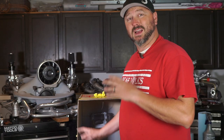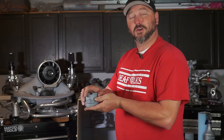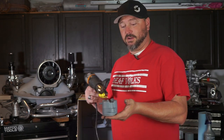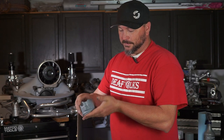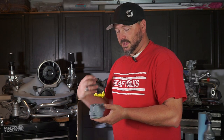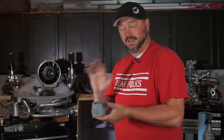All right, I've got all the primer on there — a few good heavy coats. I sprayed it a few minutes ago and I'm already touching it and it's already dry, and I'll show you how I did that: good old heat gun. This way you're not waiting an hour or two hours between coats. Once you have all your primer on and every little corner covered, the primer is very very important to making the paint stick — it's like the underwear of the paint. Good primer is the foundation for good paint on anything you do.